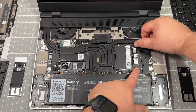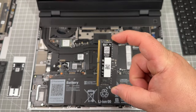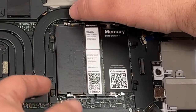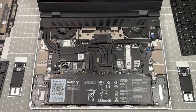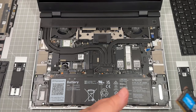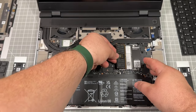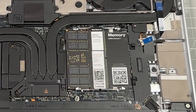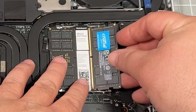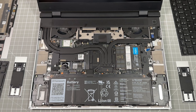Next, let's go over to the RAM and pop off the 8 gig sticks — two 8 gig sticks, that's 16 gigs to start, which looked like single channel since it's only on one side of the board. We're upgrading to a total of 64 gigs, so each stick is a 32 gigabyte module. On the first slot the non-label side faces up — make sure you hear that click and you're good. On the second one the label side faces up; push it in and click it down. Pretty simple upgrade — I love working with these laptops. If you like this, subscribe for more videos like this.